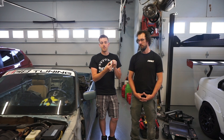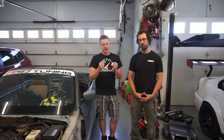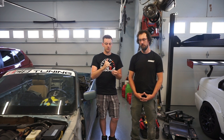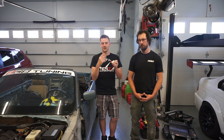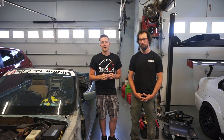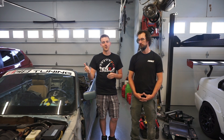Basically what we'll be doing is taking the power and the ground on this USB charger and wiring it directly into a power and ground. Then you'll just plug in your phone. It gets a little bit messy and it's not the most pretty thing, but you can just slip it behind the dash and have your cable coming out the front. If you never change your cable it doesn't matter much, but if you're changing it a lot you might have to look at some different options. We're going to show you a couple of different ways to do this so that we can have our phones constantly charged whether the car is on or off.